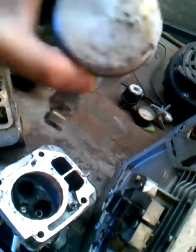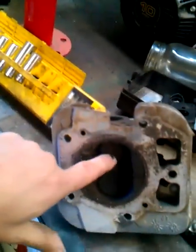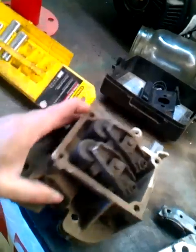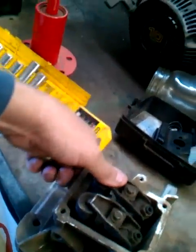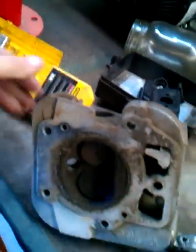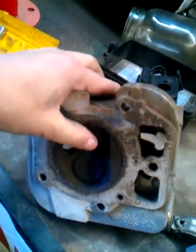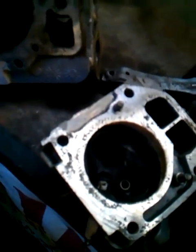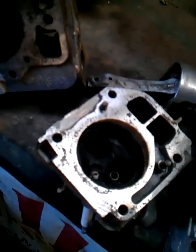When it comes back up the second time, these are what they call the valves. On this piece of equipment, this is an overhead valve. The valves open and close depending upon where the engine is in the compression stroke, or if it's an intake stroke. These valves are also sometimes the guilty parties on why you're losing compression. So there are several things I want to show you.